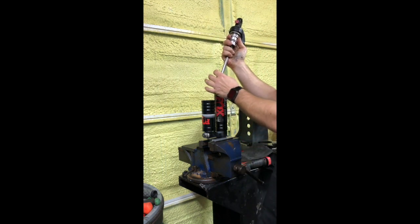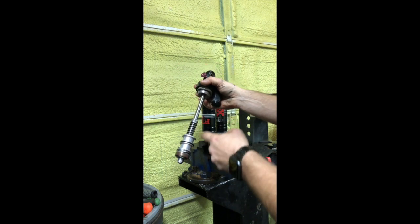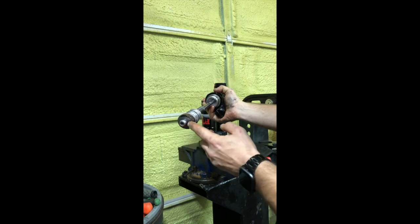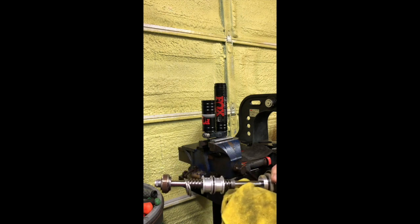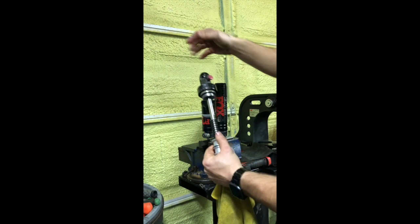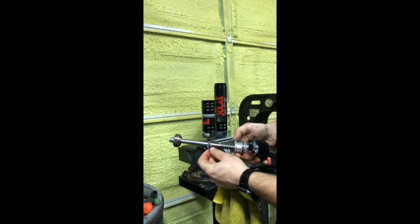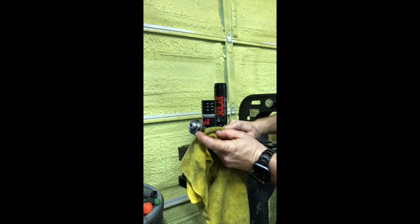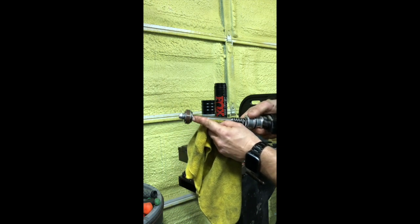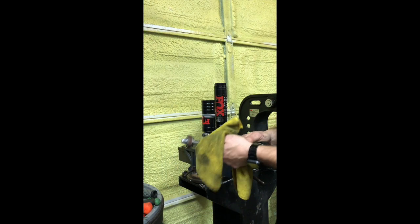We have some broken parts in this one. Here's your valving, your bottom-out spring, and your valve shims — what people talk about when they revalve a shock. This has a pro GNCC rider's valving. It's unique because there are three stop washers on this shock — they retracted back in the head. There are also two spacer washers that need to be replaced. The factory shim stack has a similar top, but on the bottom there's literally 15 shims — that's how you know it's the pro valving.